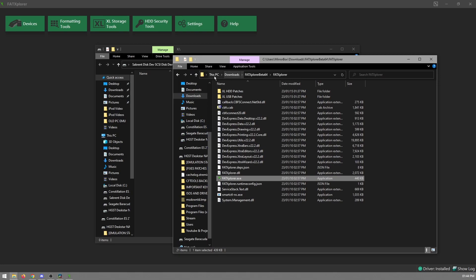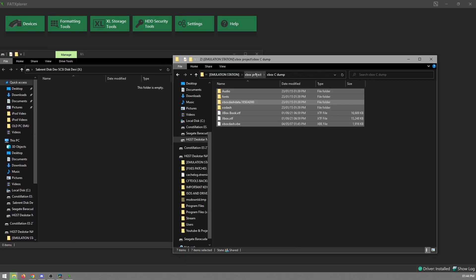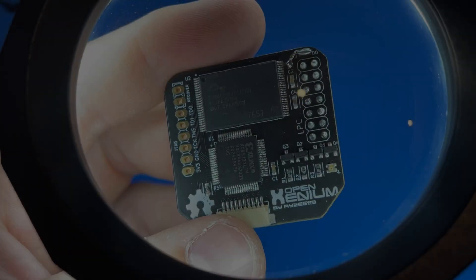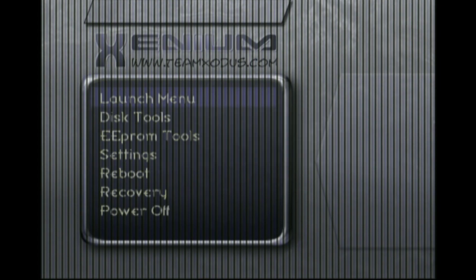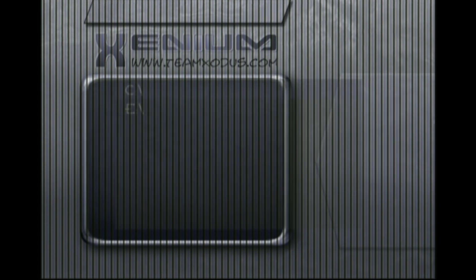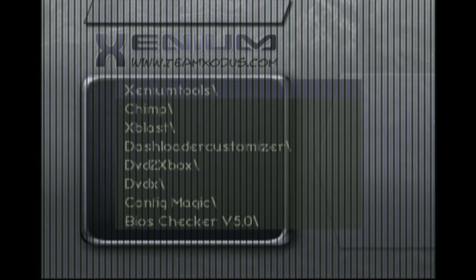While we're on the topic of the hardware modification route, it's also possible to nullify the EEPROM with a tool called NK Patcher Settings. However, I tend to stray away from procedures that modify the factory flash chips of the original Xbox, although users report online that the procedure is deemed safe and generally community recommended. So what if you actually want to do the hard mod, aka a mod chip? These mod chips often have features built in to allow an OG Xbox to boot with unlocked and even unformatted hard drives, allowing the user to configure them out of the box without needing to do any work to secure the original hard drive's contents. Essentially think of it as splicing in a replacement BIOS for the Xbox — an initial bootloader that allows the Xbox to have a safe place to fall back to assuming something is wrong with its original hard drive and its original bootloader. Quite a useful feature for those who are willing to put in the work.